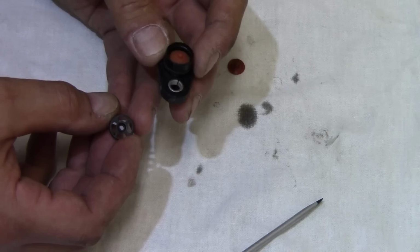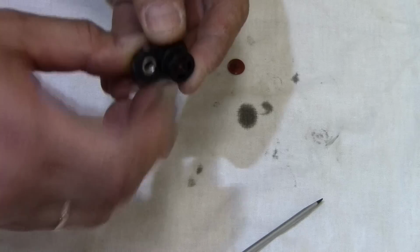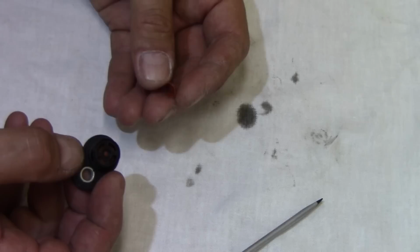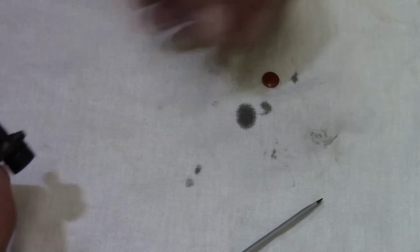And as Yevgeny suspected, his intermittent problem was that the mesh fell out for some reason and it didn't hold the membrane in place. And this was causing one of the EGR components, one of the flaps, to flap all around, which makes this noise while the engine is running. So make sure to check your membrane. If it was the membrane that was torn, then you would have a constant noise. Hopefully this will repair the problem.